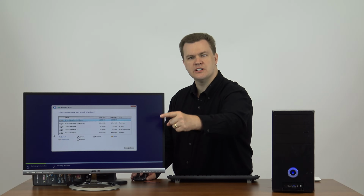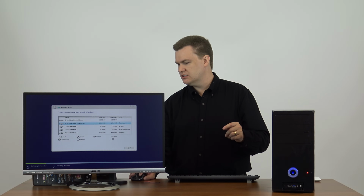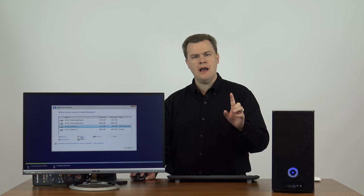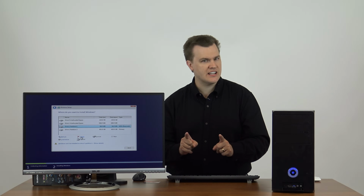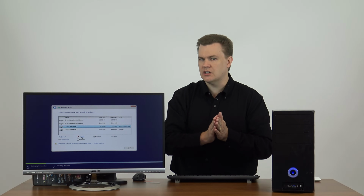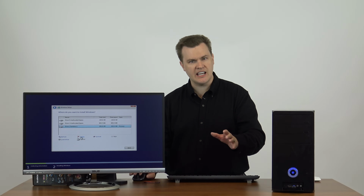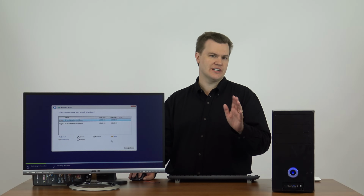And you'll look here and you'll see there's a bunch of drives and partitions. I actually have data on the hard drive in here, but I'm going to wipe that out because I don't want it. And so I'm going to delete all the partitions, and no, there's no data on here I need to save. If you have a corrupted Windows install that is totally messed up, and you are 100% sure you have your data safe somewhere else, external hard drive, a burned DVD, online backup, if you're absolutely sure, there's a lot to be said for wiping out all the existing partitions. I'm clicking delete as I hit each one of them to wipe them out to make absolutely sure there is no corrupted data left over. This is needless to say, you should not do this if you need to save your data. But that's a conversation for another time.